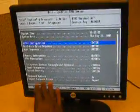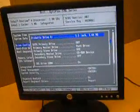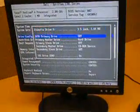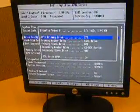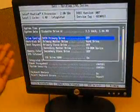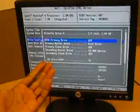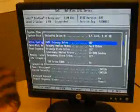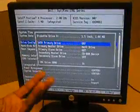That opens up the BIOS screen. In the BIOS you'll see drive configuration. When you hit drive configuration and press Enter, that brings up a sub-screen. On the sub-screen you'll see the serial ATA drive. Go to serial ATA and hit Enter — that should automatically turn on the serial ATA, and then you have to reboot your computer. Once you reboot, your drive should be ready. The last stage is to format your drive using Windows administrative tools or any formatting software you have.